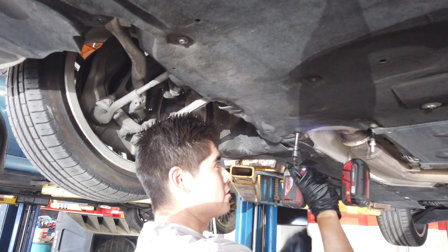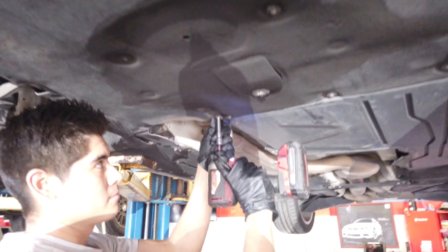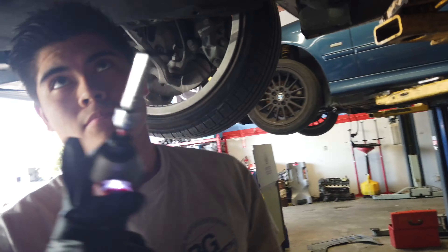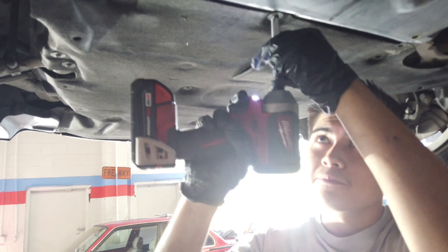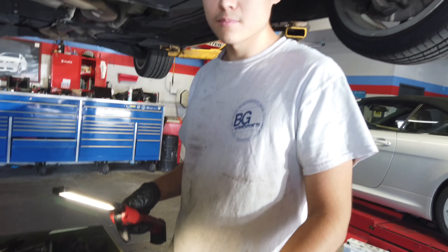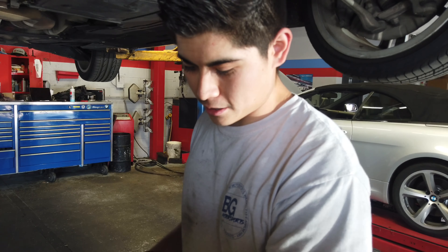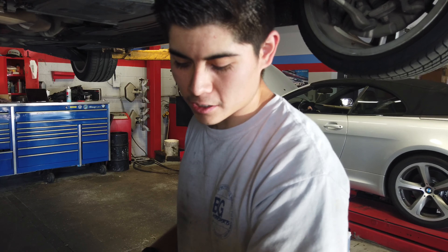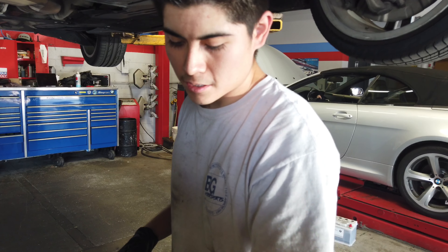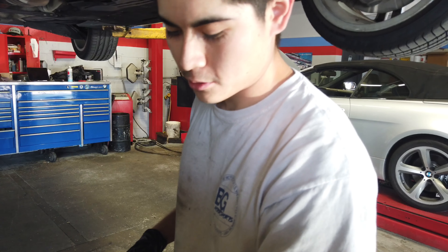How do you think we get the middle back? Oh, so it holds — yeah, it holds. That's a good tip right there. You heard it from Eddie. Preliminary, what do you need? We're going to need a 90-pick — it usually helps taking out the clips. A ratchet with a 10 socket for the clamps, and a 3mm Allen for the sensor that we're going to be taking off.